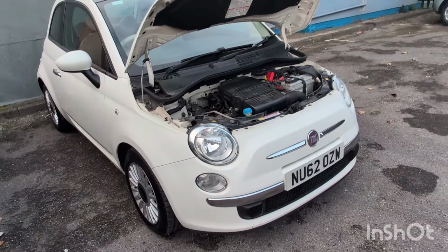Obviously for the Fiesta, I went round and there was nothing wrong. I started it up and it didn't seem to have any issues with the oil pressure light coming on, so I thought, right, that's a good start, but it's still a big risk, so bid accordingly. I heard a blow from the exhaust pipe. That might cost £100 to £200 to repair. The tyre pressure warning light was on, so it might need a sensor, let's say another £100. So you bear that in mind in your prep. I shook the steering wheel and thought, right, that's 2 track rod ends, roughly £100. You do just get to know what things cost in the end. It is good to have that bit of knowledge. I bid accordingly, got it for a very good price, and left myself plenty of margin in case of the risk of wet belt failure.